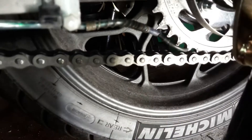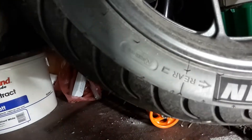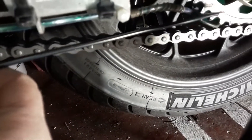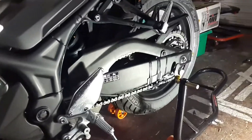I'm going to remove that nozzle, back to the point where it joins. I've got some 4mm copper tube, and I've run a bit of insulation tape on it just so it's black and blends in with the bike. I'm going to cut it to length, shape it, and aim it at the sprocket.